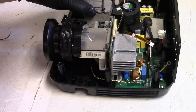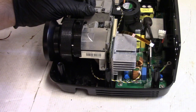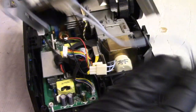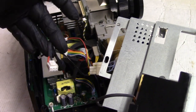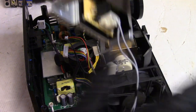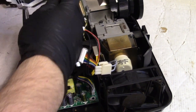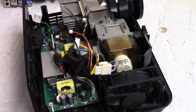Snug that guy down. Then we'll put the metal frame for the main board, and then the main board. Alright. So let's get the metal frame in. We're going to plug in the PFC here, this wire. And then this wire is going to go over to where the lamp connector will plug in. And then all these guys are going to go on top. And then we have our ballast control. So let's plug in the PFC. There's a little bit of dust here. There we go.